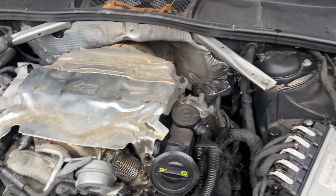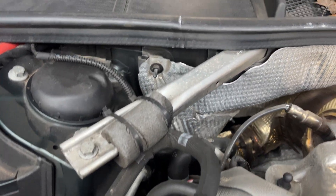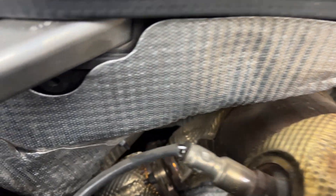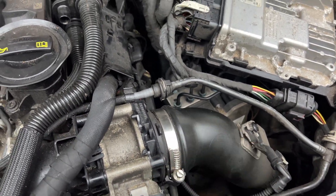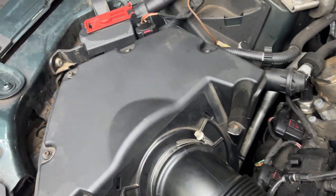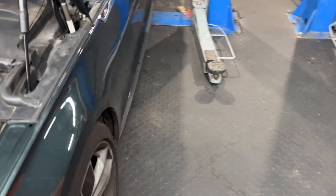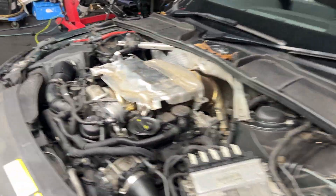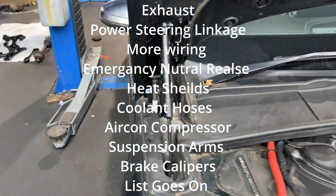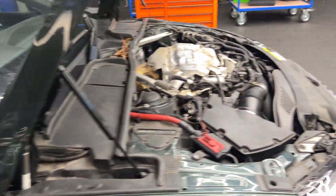To take an engine out of one of these it isn't too bad. You've got some hoses, wiring, fuel hoses, evap, some more coolant hoses. The exhaust gets disconnected from underneath. On the front we only really have the intake pipe — the air box needs to go, there's some wiring underneath the air box that needs to be disconnected as well. Underneath we only really need to disconnect the brakes from the hub — we just don't want to start undoing brake hoses. Then subframe bolts and the prop shaft in the middle, but that's about it.